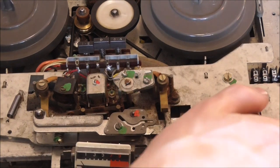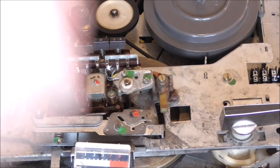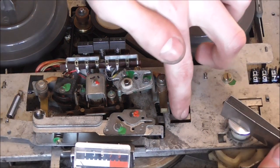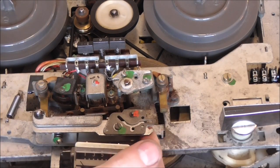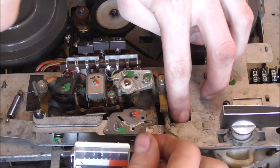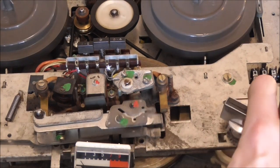Well, obviously we can't put the covers on yet because when you take a close look, the pinch roller isn't moving into place. That of course is everything that transports the tape when playing. This thing here is powering this lever and the pinch roller is on that lever, so as you press play this lever presses that against there. Since they're both in the wrong position, all it should take is levering this one below that one and having them both engage like that. Yes — wonderful.